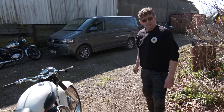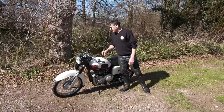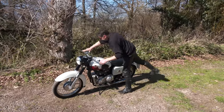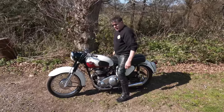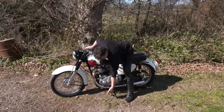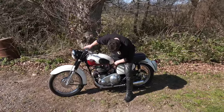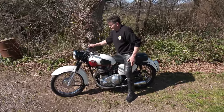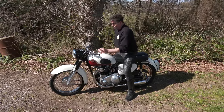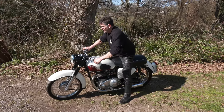We'll start it up for you and you can hear it. I haven't started the bike today — pipes are really cold. Because it's only been finished this week, I'll give it choke this time. I'm going to tickle the carb up and give it choke just to fire it the first time. The compression's quite high. The sitting position is actually harder than you expect — if you're short, your feet are quite a long way down. Side stand is spring-loaded so as soon as you move away, it springs back. Turn the fuel on, tickle the carb until the petrol comes out the top, give it full choke. Advance and retard: fully advance is forward with a slack wire, fully retard is back with a taut wire. Bring that back a little bit, find compression, and give it a kick.